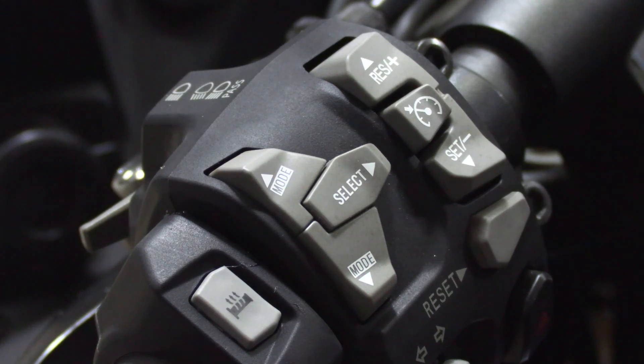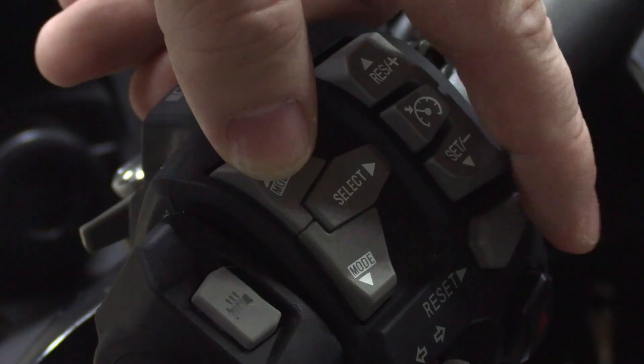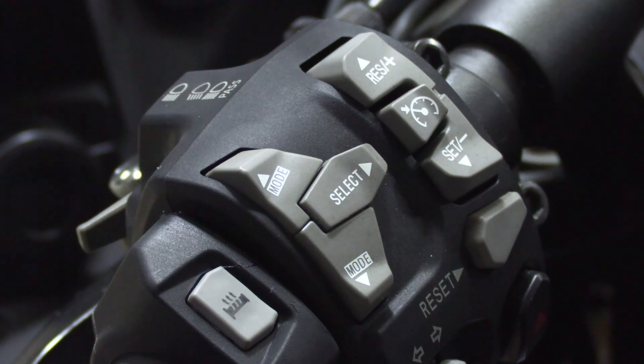First, turn on your motorcycle. The service manual actually tells you to have it running, so go ahead and fire the motorcycle up if it'll run. You could try it with just the key in the on position, but chances are it won't work because the service manual tells you to start the motorcycle. Hit the top button to get to the odometer — the manual says to have it on the odometer. Then push the top mode button and the reset button and hold them. The code should appear where the odometer normally appears. This will be a simple numeric code such as 11 or 12. There can also be letters — for example, B means it's an ABS system, E means it's IMU.